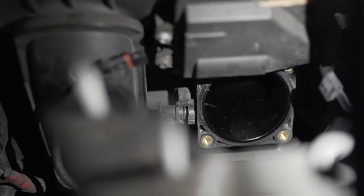Make sure nothing touches this positive connection at all. Now we're going to remove this second starter bolt, loosen it and take it out. The bottom one is a short bolt so you can't mix them up, that's for sure. Now we're ready to remove the starter — sometimes they get stuck. I'll put the screwdriver right here and just pry it out, nice and simple. And get the starter out of the way — that's the troublemaker right here.